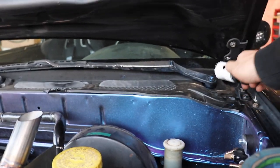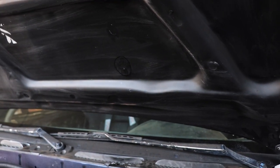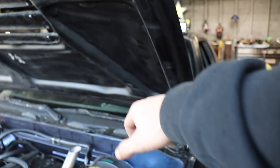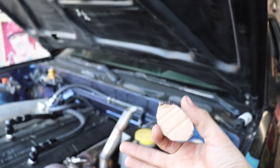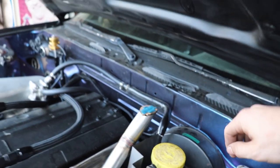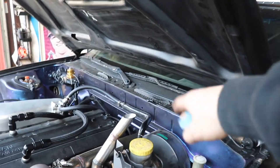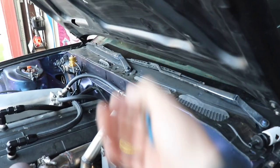I'm going to use this hole saw in the middle and then just file away the rest of it so we get a nice clean finish. If you want to have your wastegate come out of the hood and you need to know exactly where to cut, take a piece of cardboard or paper, cut it out to the shape of the top of the wastegate tube, set it on there with some tape on the backside, and when you close the hood it'll stick to the hood so you know exactly where that needs to be. You'll probably have to sand or file it out a little bit more, but that'll give you a very good idea of where the tube is actually going to come out.